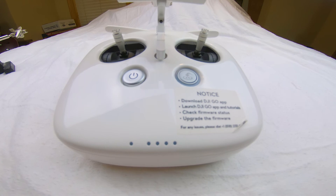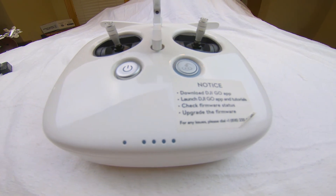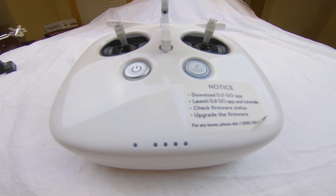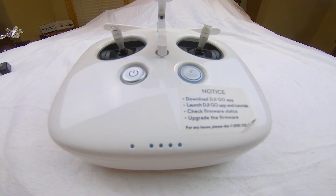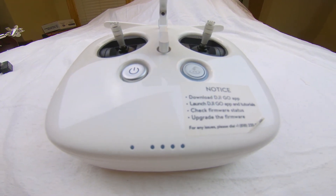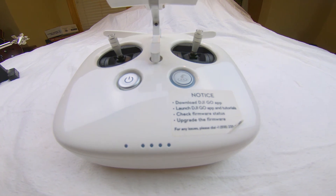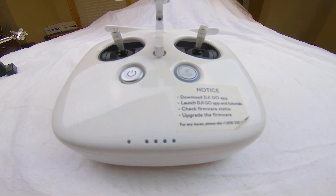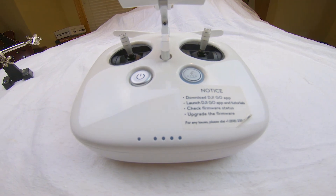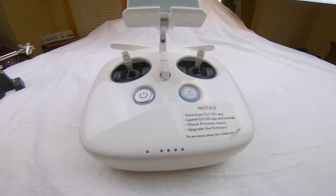If the chip is reporting the wrong voltage, my suggestion would be to keep this thing cool while it's charging — keep it in a cool place in general, don't let it heat up while charging. Maybe use a laptop cooler underneath it or a fan blowing over it, just to keep it cool and prolong the repair so you can continue using it. This seems to work and it's going to get me back in the air. If it fails after a couple of flights, I'll post that in the description or comments. Overall, I'm happy — I've got a four bar battery indicator and I'm going to take it out flying.